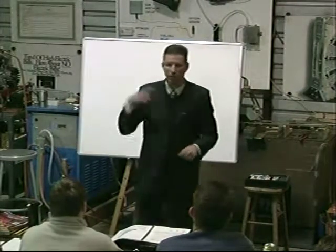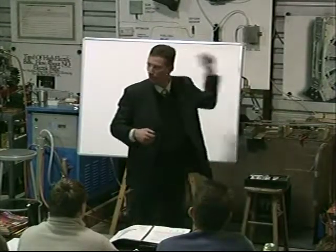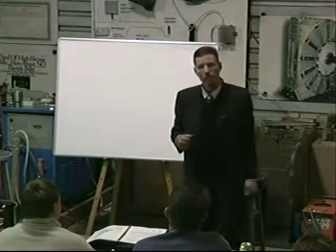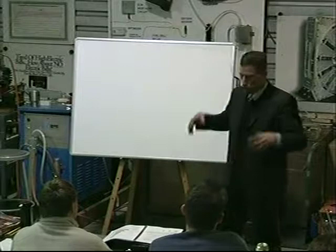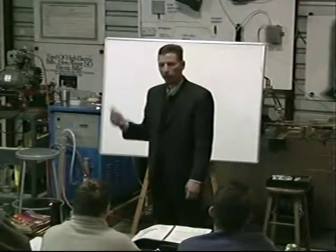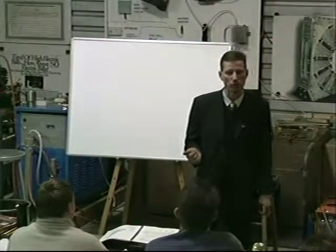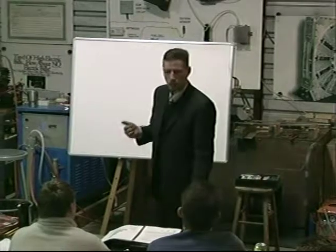And if you've got a recirculation system where you're going to run it through this vaporizer or run it across the fuel rail through a regulator back to the tank, do you want 500 degree fuel riding back in that fuel tank? I don't either. The science says just strap it to the exhaust pipe, but the reality is we don't have vehicles that are designed for that kind of heat in the fuel. We're going to kill fuel pumps. We're going to kill injectors and possibly our customers doing that stupid stuff. So keep it to engine coolant.